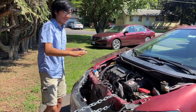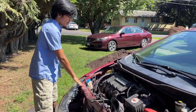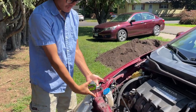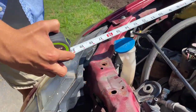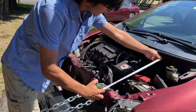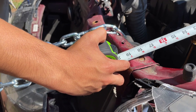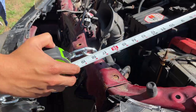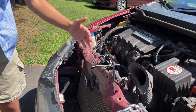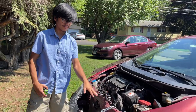We don't know exactly what the frame looked like when it wasn't broken, so we're going to use this reference point here — this side is undamaged. We can use a distance of about 20 inches to see what the damaged side should be. It looks like it's about 19 and a half inches here, measuring from the front edge. So we need about another half inch of bend. We need to bend it forward at the middle — that's probably the most important part — but we're going to bend it here first.